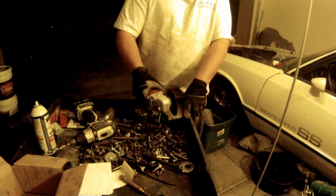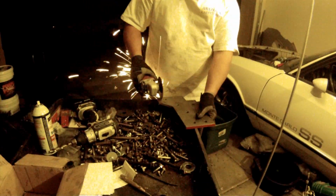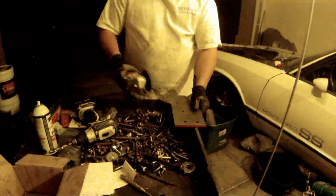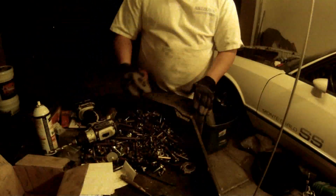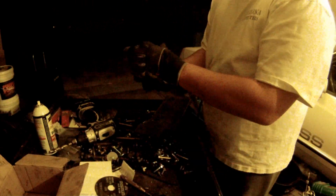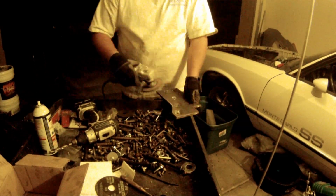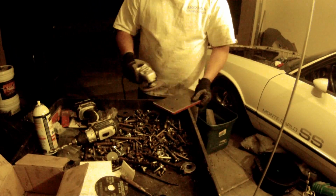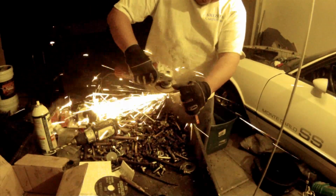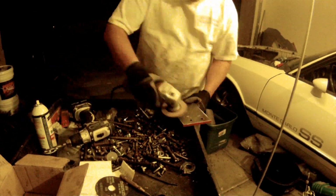Just think of it. You have the intercooler dead center of the radiator area, and in this Monte Carlo, it's a pretty huge tunnel. So the intercooler is going to be dead center in front of the radiator. It's going to have a metal plate, and then from that metal plate, all 4 walls, the top, bottom, and the 2 sides, are going to go off on a small angle towards the front of the car. So as the air rushes in, it's like a funnel, right? It's going to funnel the air into the intercooler instead of just hitting a wall and causing a whole bunch more turbulence around the outer corners that are all welded to the tunnel. So that's going to be a video coming up here pretty soon.